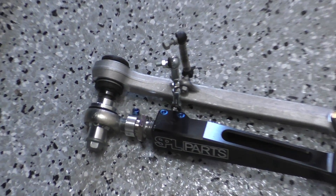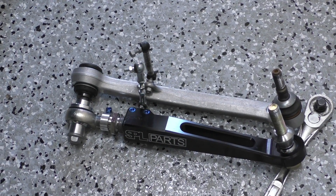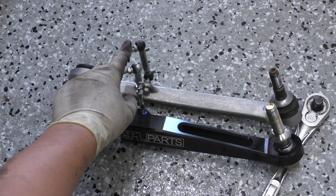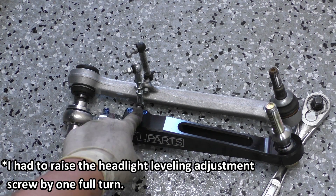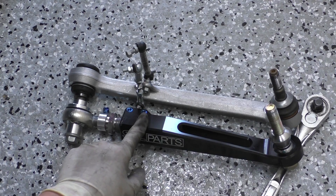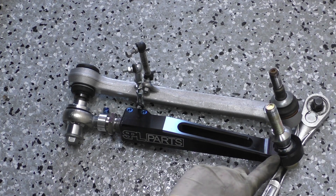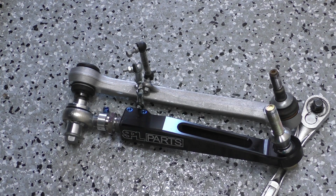Let's talk a little bit about the headlight leveling adjustment mechanism on both of these arms. If you have SPL like I do, the headlight leveling adjuster they give you is actually a little bit short compared to the OE one, meaning you'll have to adjust your headlight leveling. You could rotate the arm so the top flats are even and it would reach the same height, but I didn't do that because I wanted the ball joint to be centered just like on the OE arm — that's far more important, because if you make this arm level and straight you may run out of articulation on the ball joint, which could be disastrous. So just note: check your headlight leveling afterwards.